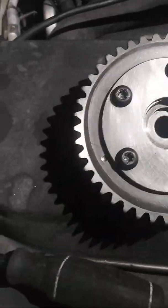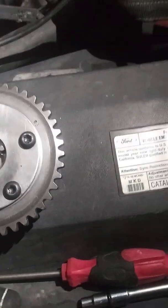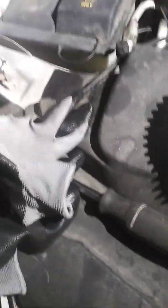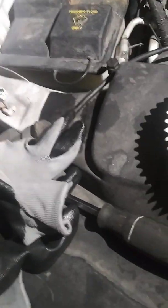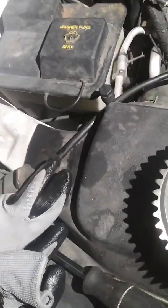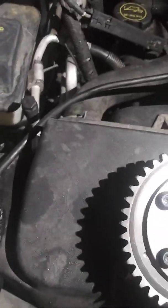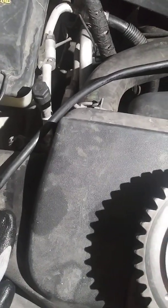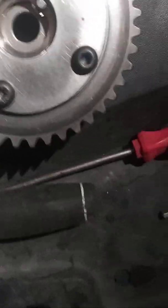First you break it apart. What's going on is that inside there's a locking mechanism that's spring-fired, meaning on one side there's oil pressure that pushes it and relieves it and opens it, but to close it again it has to have the spring tension to push it back. After many many cycles of moving back and forth, the spring becomes less springy, thus creating the ever so dreaded knock, because it's not locking into place.